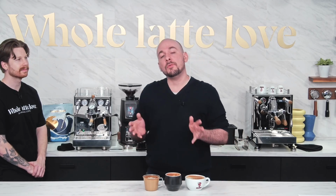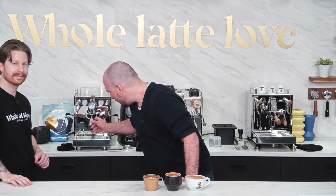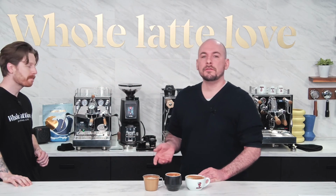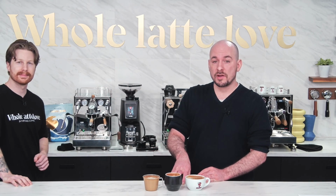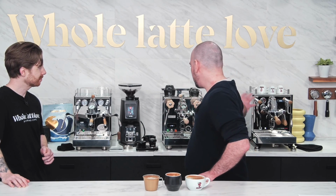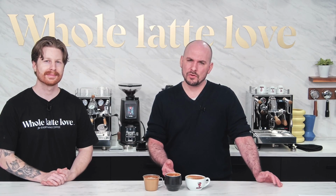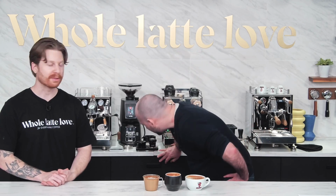So RDY that we just saw, that means ready. That means if you've programmed 200, 201, for example, and the probe's reading 200, 201, it's going to tell you that you're ready to go. So what'll happen is, if the machine gets a little too hot, it's going to ask you to flush before you start extracting. It's the same as on, for example, a Pro 500 or a Sole, but you are being alerted in real time that you should flush if you want to get as close to your desired temperature as possible. Sounds pretty smart to me.